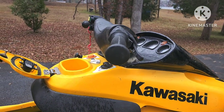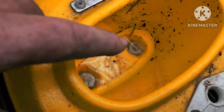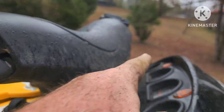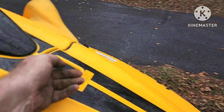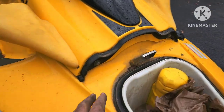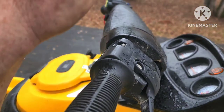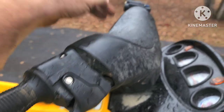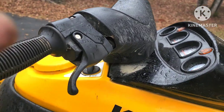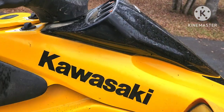Let's go ahead and pull the gauge on this one. You've got to pull this piece of foam up and re-glue it with some glue. There are two 10-millimeter bolts down in there, then a Phillips and another Phillips - then this opens up where you can pull that off. The foam has got two 10-millimeter bolts here to do the front part of the cowling, and then the rear two. Then you've got to take this off with all the Phillips screws that hold these panels off so you can pull this whole top piece off to get the gauge changed out.